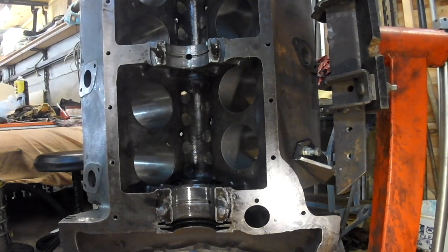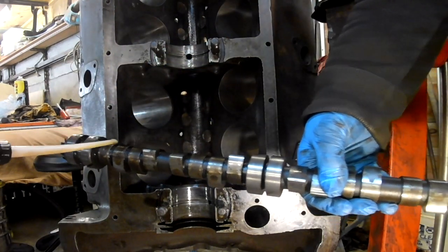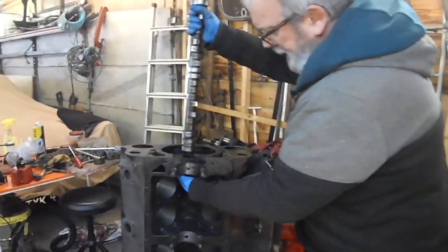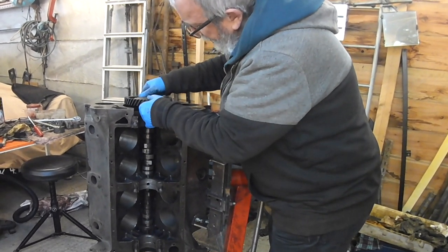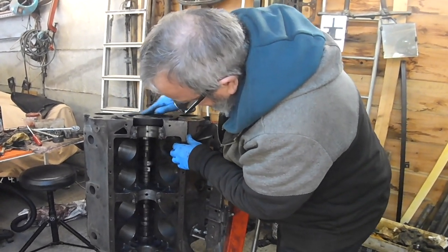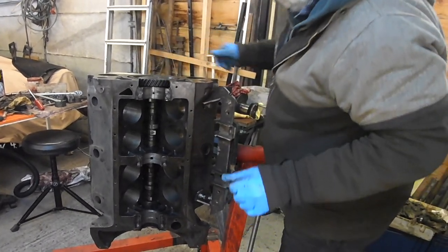That's it. What we do now, I'll do this, not because it's hard, but just put a bit of oil on there. That's it. And there. And there. Just going to lower the cam in, do it vertical, because I find it a little bit easier. See where you get your fingers caught. Okay. That's it. What happens, Jack, these bits go around, and when that bit goes around, it pushes them things up and down, because they're cam followers.